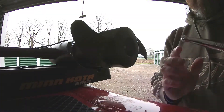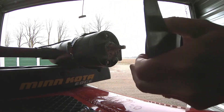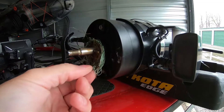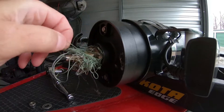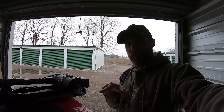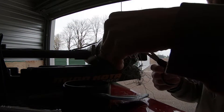I had to chase my washer. I'm going to peel that off — well, that doesn't look very nice now does it. Look at what I just found — is that not a disaster? They tell you to pull these things off and check them every season, and I have got a whack of braided fishing line in here. This cannot be good — maybe that's why it's been running like crap. This is why they tell you to pull the prop off and look every year. There's a lot of line — I don't remember losing this much line off any of my stuff.